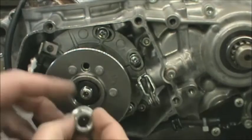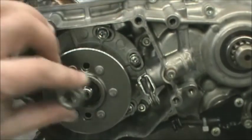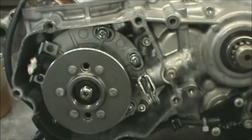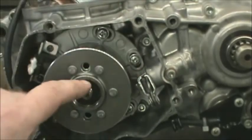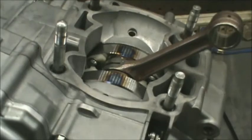We're going to put a little bit of blue Loctite on the nut. If you're looking for the torque on this nut, it's kind of a pain — it's not in the manual where you'd expect to find it. It's actually under the electrical section, and they call this a rotor. The torque on this nut is 40 foot pounds. The bottom end is pretty much completely done, with only minuscule anything else left to do in there.